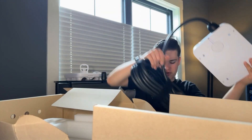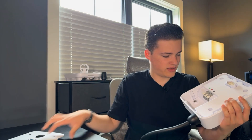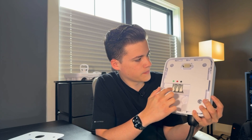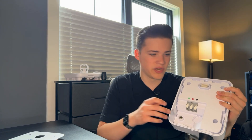And then we have the massive charger unit right here — this thing's huge. On the charger there's a mounting guide, and in here is the actual bread and butter of what it does. Essentially you take a line in right here and then it comes out — it does all the power conversions in here. Pretty much all this is basically a very fancy AC-to-DC converter, converting the alternating current over to DC current for the car. It does this at 50 to 70 amps. You're supposed to have a 70 amp breaker, but it does up to 50 amps of charging for the device.